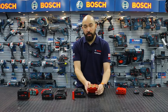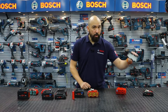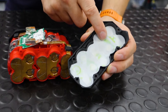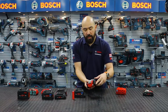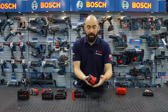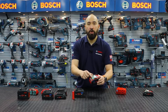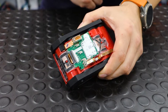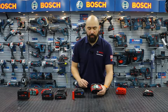We're wanting to draw 90 amps of power out of every one of our 18 volt ProCore batteries. On the side panels we also included TPE — thermoplastic elastomer — essentially a rubber gasket that sits on the side and again helps pull the heat out of these batteries. So you've basically got 360 degrees of heat being pulled out of the battery when in use. On the top there's a well-protected Electronic Cell Protection module which communicates with the tool to keep the power level and current consistent and stop these batteries from overheating.